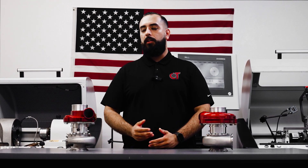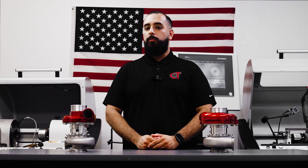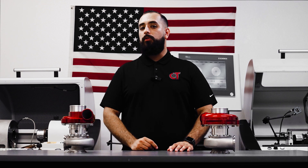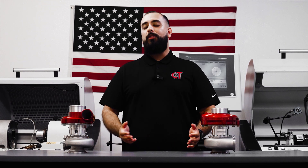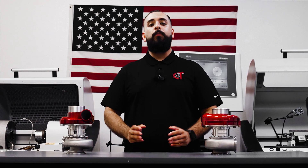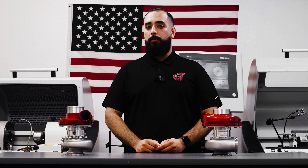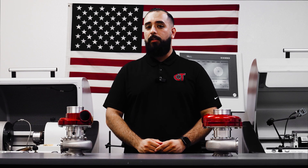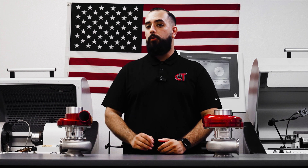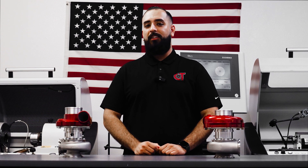A small douse of oil, quick in and out, is really all they need. We took advantage of this concept and decided to create our grease lubricated turbocharger — thus, the oil-less turbo was born. Our turbochargers do use a proprietary grease. You can't, unfortunately, go out and just use an off-the-shelf wheel-bearing grease. Our grease is a non-channeling grease that won't eventually gunk up or foul out your turbocharger. In fact, it dissipates quite cleanly. It's fluid enough to allow for the same mechanical efficiency as a conventional oil-lubricated turbo, but still strong enough to withstand the harsh conditions under which they live in.